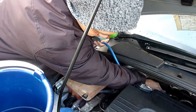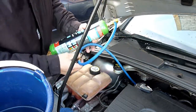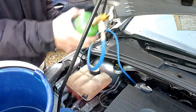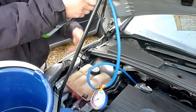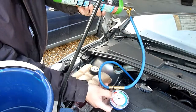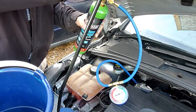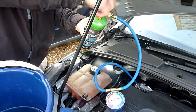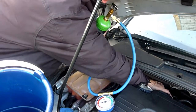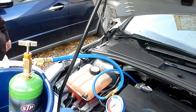That's on properly. It's adding in gas already. It must have a leak — I just need it to be good for a little while. I'm at quite low pressure and I'm not sure I've got enough fluid for this. I'm going to switch off the valve — I haven't even turned the engine on yet. I'm going to dunk the bottle straight into the warm water to build up the pressure, then turn on the engine.